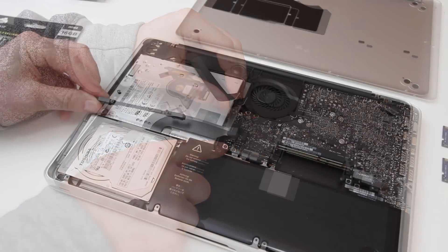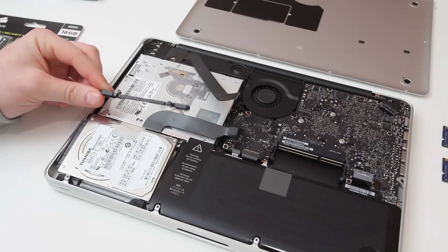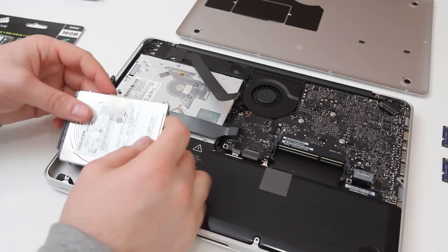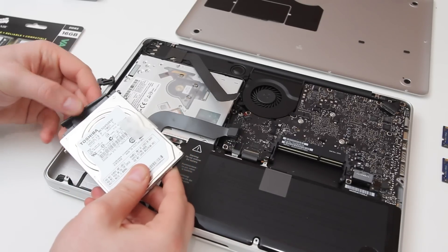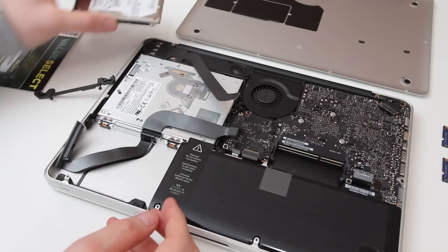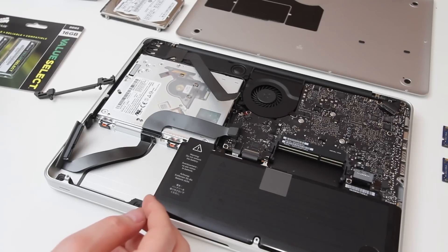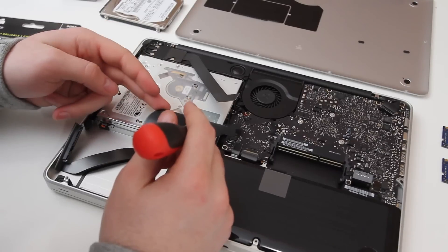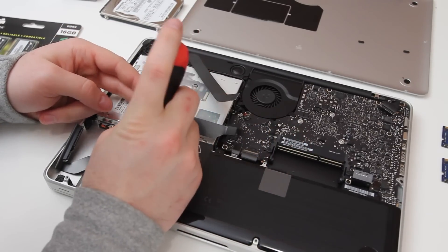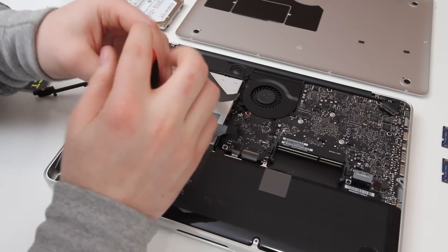That performance doesn't really benefit in a big way from an SSD. So what you want to do here is remove all the ribbon cables connecting the optical drive and the traditional hard drive to the logic board. Then you're going to need to remove the traditional hard drive, even though it's only going to go back into the location where it came from. You are going to want to look at the high-res photos provided through the link in the description, and use this video along with those as a companion to make you feel more comfortable doing this upgrade yourself.